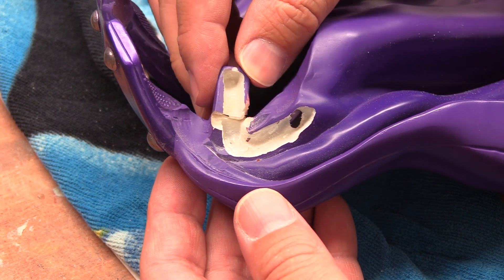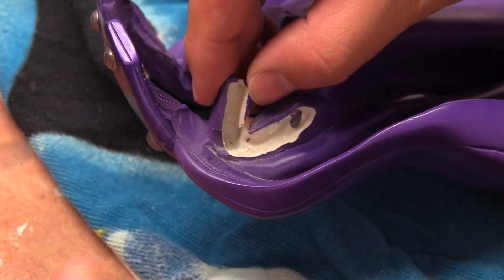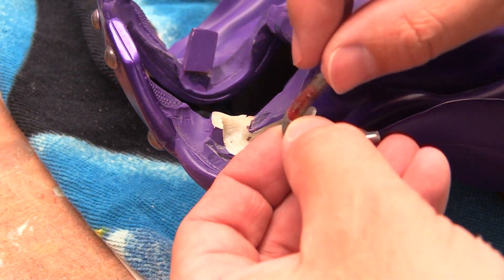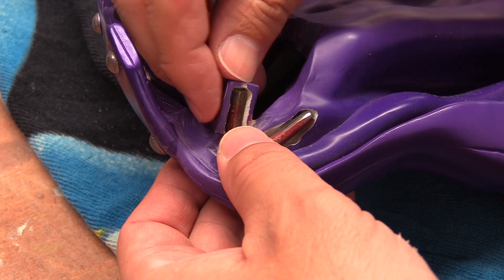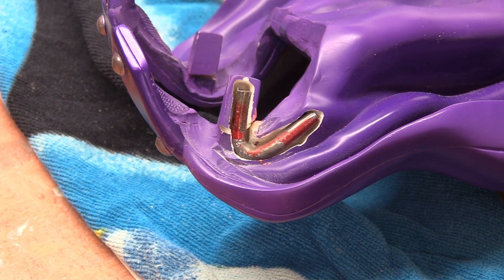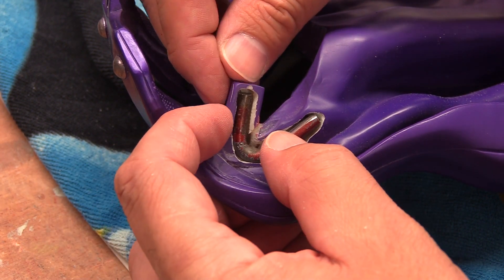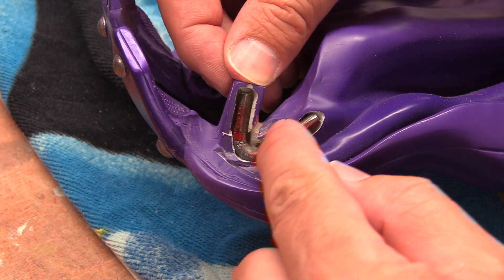When I popped this out, this broke off because there really wasn't much glue holding it left. The person who did the prior repair put a little tiny rod in there, but that was never going to hold this up. So what I'm going to do is glue this back on, mix up some Aves, squeeze Aves in here, and then I've got this piece bent up that fits in here pretty well now. I did a little test to make sure this goes back up fine. Once I get the Aves patched up, this is going to have like a little extra wrinkle that I'll sculpt over — there's no choice, I have to do it. They should have put some kind of a bent rod up around here from the factory, because there's no way this was going to hold up over time.